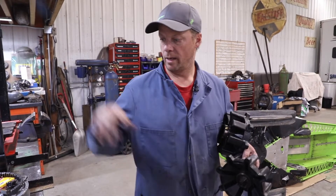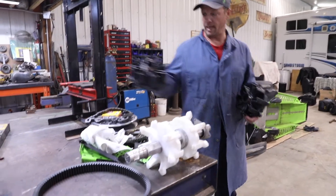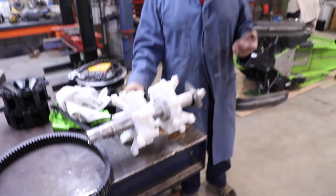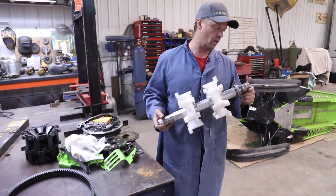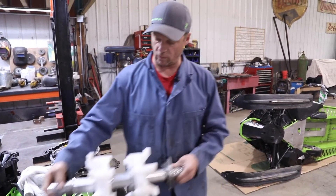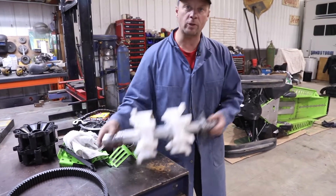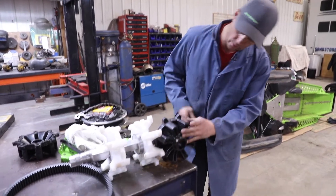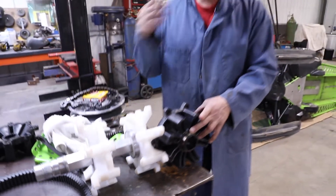That's why I went with the Dew track, but in order to put that on you have to take the 3.0 drivers off and get 3.5 pitch drivers made. None of the manufacturers offer this system for this older sled, so you have to suss it out. My good buddy at Mount Magic, Ken, he's doing this a lot, so I asked him to find me some drivers. He ordered me up a set of 7-tooth, 3.5 pitch drivers, which are a little bit bigger in diameter, and that's going to help it turn over nice, gears it up a little bit, so I'll get a little more speed out of it.